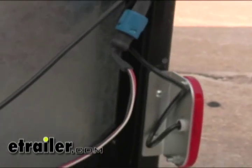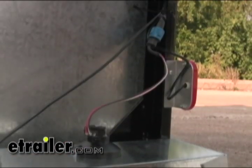In this example, one way to check it is to look at the four-pole at the end of the trailer at the tongue and follow it down. If it doesn't stop anywhere or have any open parts connecting to the frame, then chances are the ground is run inside the wire harness.